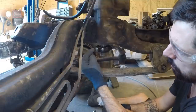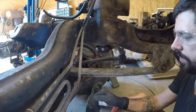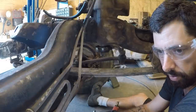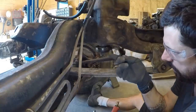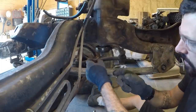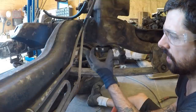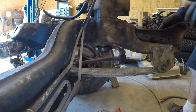The next thing I'm going to do is get out the blowtorch and torch it, going around trying to get the pitman arm as hot as possible while keeping the shaft as cool as possible. There's a trick where you blowtorch the outside until it's insanely hot, then take a can of spare air — you know, for cleaning keyboards — flip it upside down because it's 134A refrigerant, the same as in your AC system. It sprays Freon directly and freezes things. So you freeze the shaft, heat up the pitman arm — that'll separate the two. I'll start with just the blowtorch. I'm using map gas; it burns a little hotter than propane. My pitman arm puller isn't big enough for this heavy-duty truck.